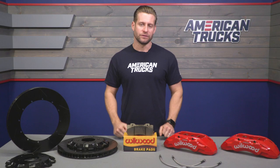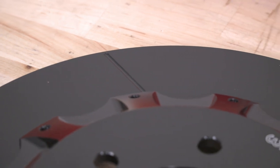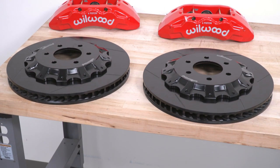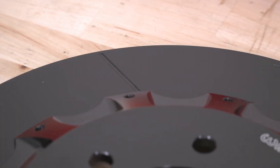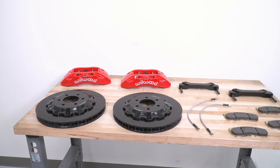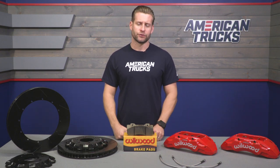They don't just rebrand a kit from a Mustang or something like that and call it a day — they built this kit specifically with truck use in mind. That two-piece rotor design is going to be a lot lighter compared to your traditional one-piece cast iron rotor. Another big draw with a two-piece design is that it will be crucial in helping heat dissipation, preventing excess heat from the brake friction surface from transferring to the hubs and, more specifically, the wheel bearings on your rig. That's due largely to the aluminum center section, which also helps reduce rotational mass in the process.